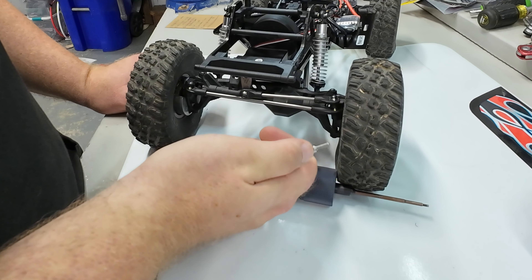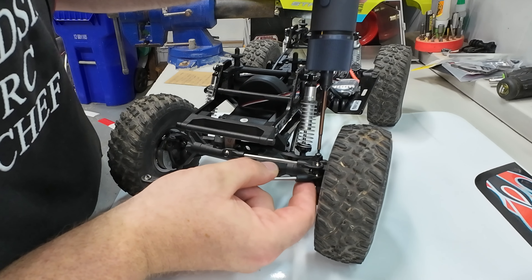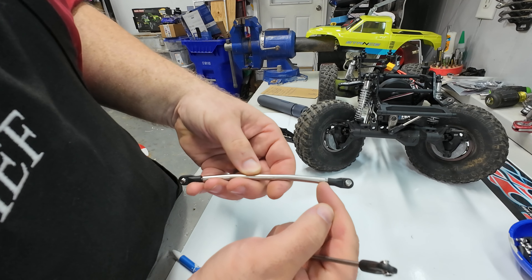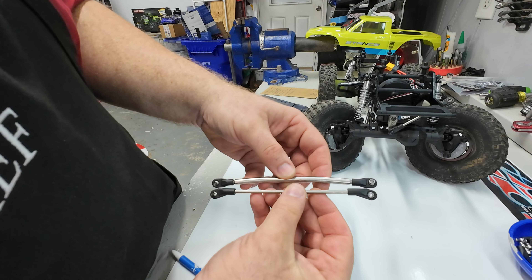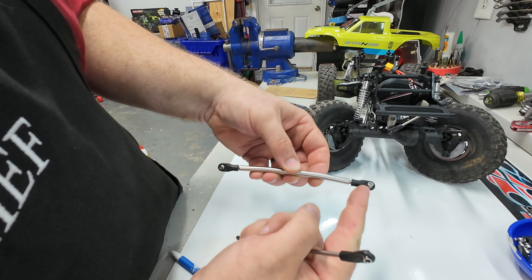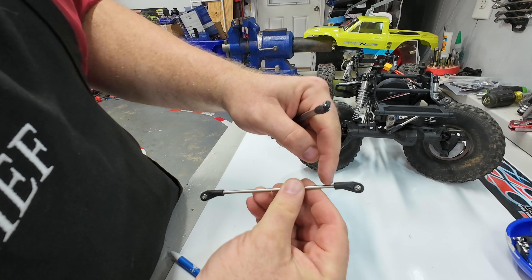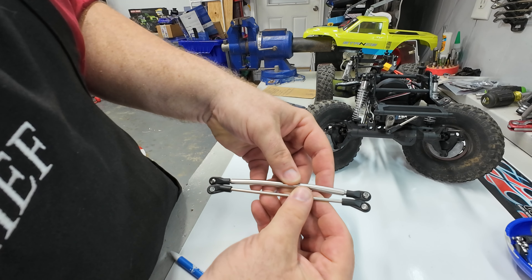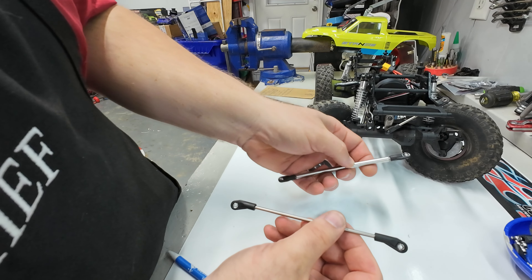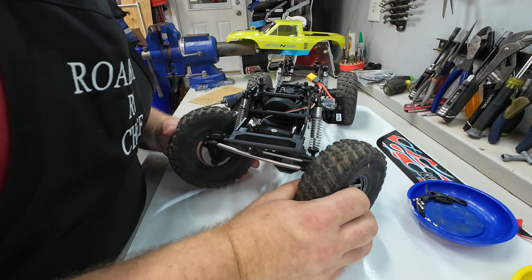These are curved links here at the end — curved plastic. The other one's not, so we're going to assemble it and look. In order to get this to actually be the same length, I still need to back it off a millimeter or two on each end. Here you have a straight out, then a flat, then a straight out — the metal piece is actually straight, the rod's actually straight, but the ends are curved to create some distance. I actually measured the offset — you do get slightly more clearance this way. Bolting it up and checking: it looks like it does clear.